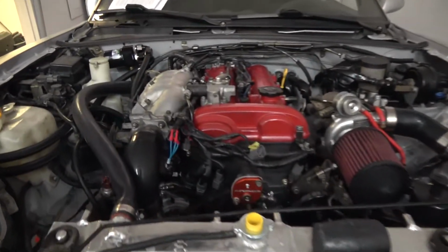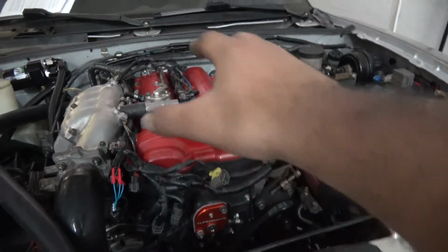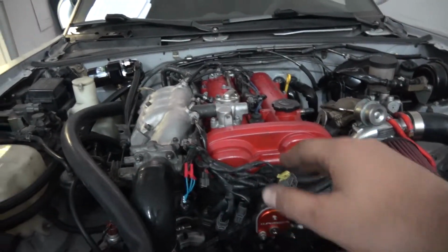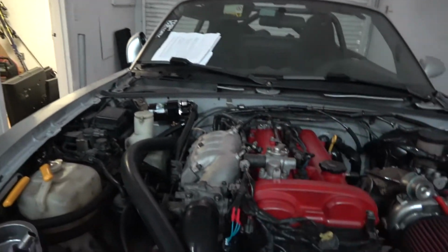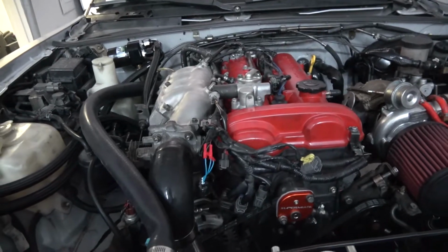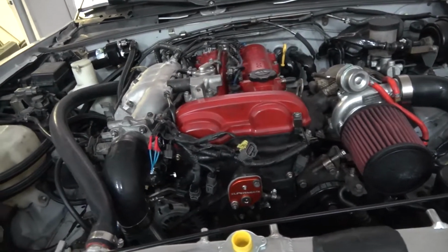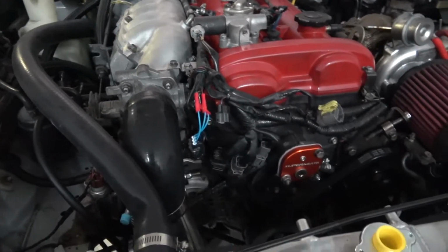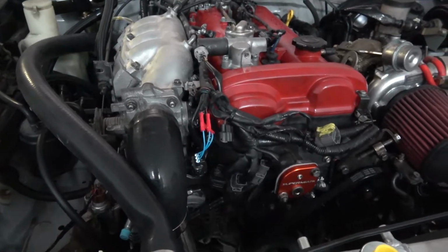So this is a bit of a pain in the butt. I was working on the car off camera. The car starts, well, it runs poorly. That's why I was looking at the ECU, trying to get it to idle. I was adjusting the tune, and I noticed that the throttle position sensor wasn't giving any input. Something was wrong with it. I went to check on it.